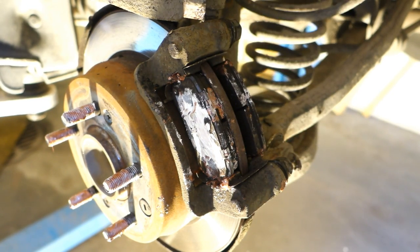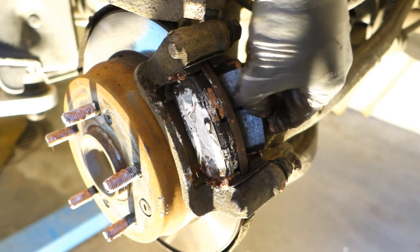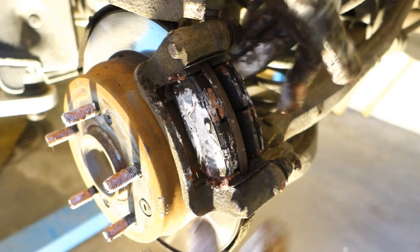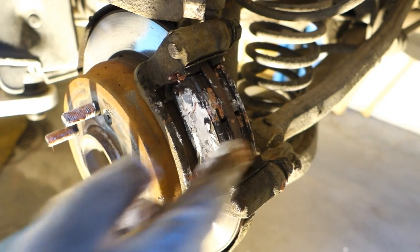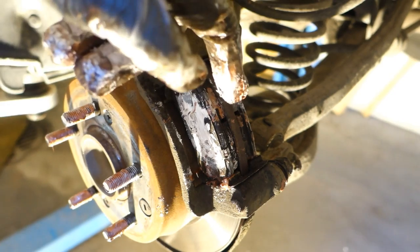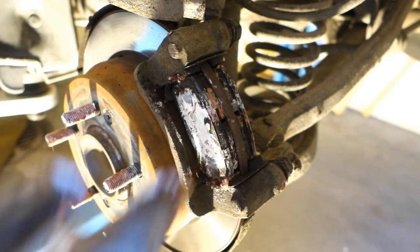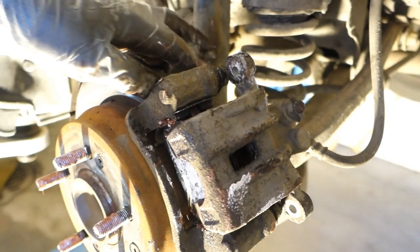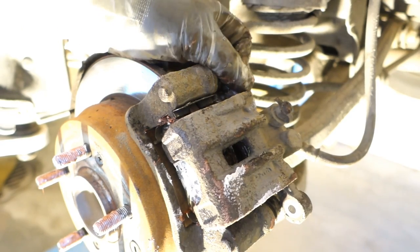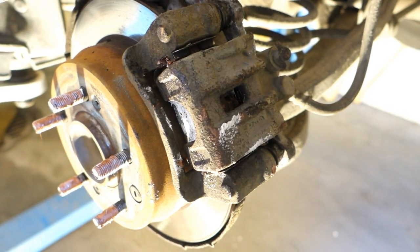And then I insert the second, inner brake pad. Let's see, this is not so easy to install. I start to press. This is quite tight. This is a Kia Hyundai problem, they are not so easy to install. Now it went in well, and we check that both pads are pressing the brake disc in the center. Then I take the brake caliper and it goes in that way. I need to press the bolt a little bit down, and also here, and move it. Now it is nicely in there, good.